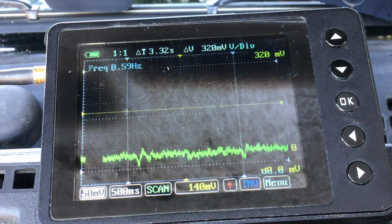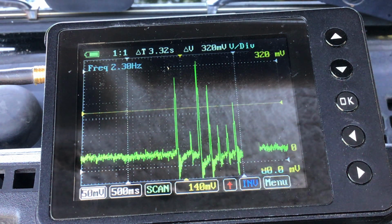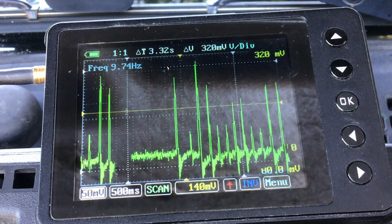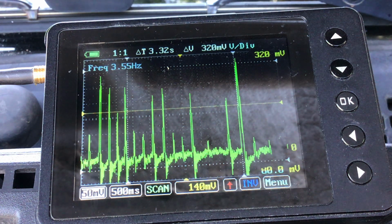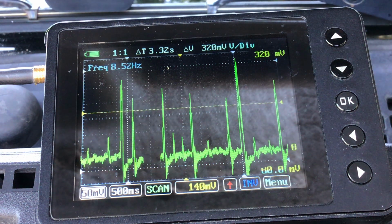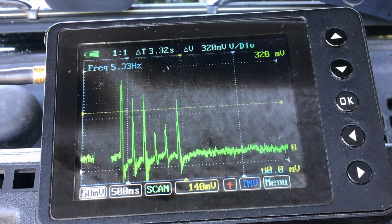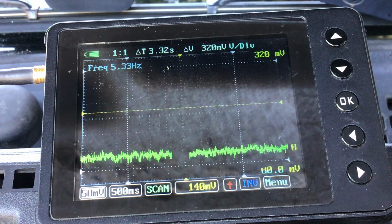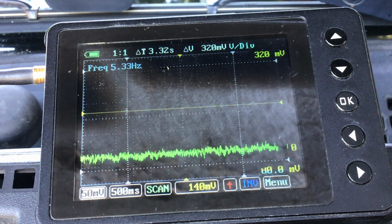Okay, now on the intake, let's see if I see anything. Okay, now we got intake action. I am blowing right past the open intake valve. Now, if we had a valve issue at TDC compression, obviously this is what it would look like. So I just simulated what a compromised valve would look like with the one-channel scope and two transducers, one of them a delta sensor in the tailpipe, a piezo sensor, and the WPS is an absolute, but at range 3, it is super, super sensitive. It's going to pick up anything. I could breathe on the thing, and it'll take it off the screen.